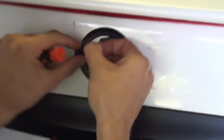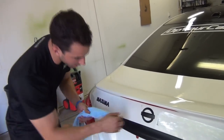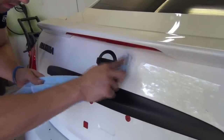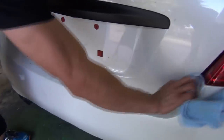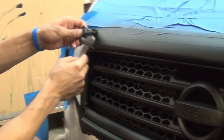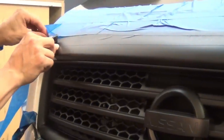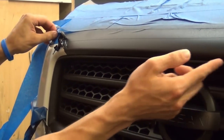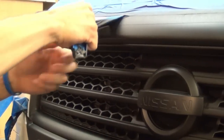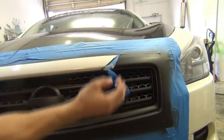Once I've rolled up enough to get a hold of it, I'll grab that edge and finish the peel with my fingers. This is where the microfiber towel comes in. When you have overspray that goes over and above where the tape is, you just take the microfiber towel and it's really easy to buff off. There's a little bit of overspray on the bottom of the bumper here, so we'll use the microfiber towel - you don't even need to give it much pressure, the whole dusting area just comes right off. If I covered the underside of this edge properly, it's going to be really easy to peel all the way down. If I didn't get good coverage, it's going to speckle and give a rough edge. So far so good - I got nice even coverage all the way around, creating that perfect edge.